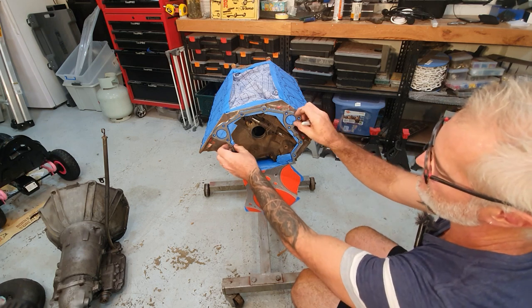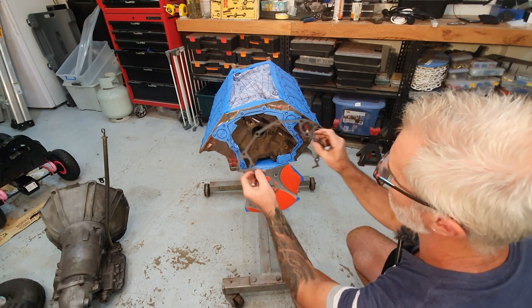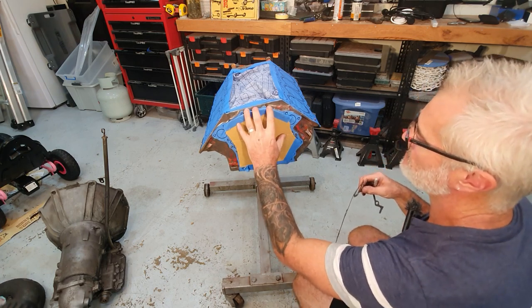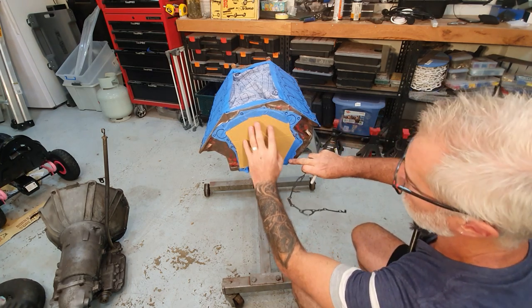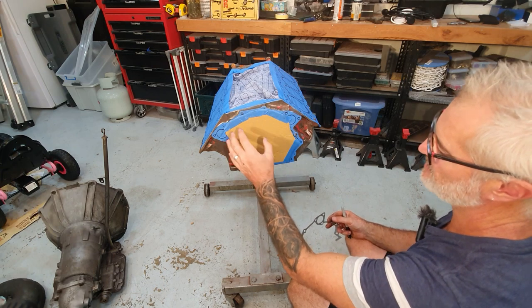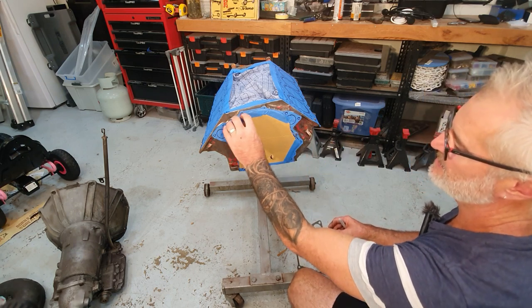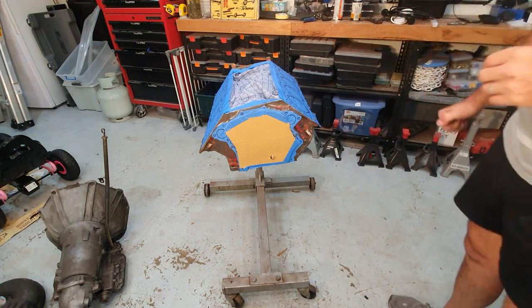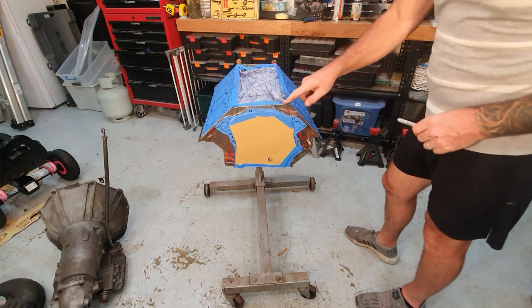So why I do that is once it's all painted, I take all the tape and stuff back off. Anything that's supposed to be covered by a gasket is covered by a gasket. Anything that's supposed to be sealed away behind things is sealed away. There's no exposed metal. I get no rust stains, and I like seeing a panel, like a component, then a gasket, then another component, then a gasket. I absolutely hate with a passion that when people just put it all together, spray the whole block, spray everything in its path, it just looks cheap and nasty. It looks like people didn't give a shit about it. Looks like they don't know what they're doing for a start.